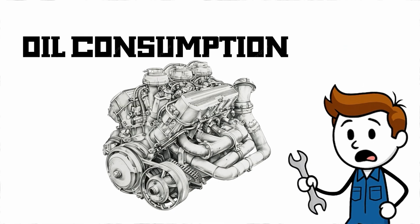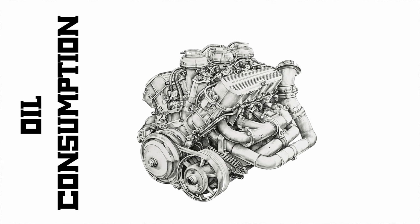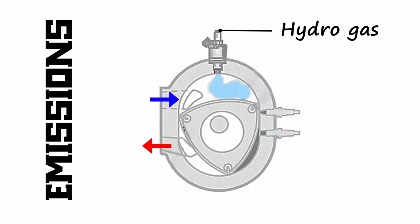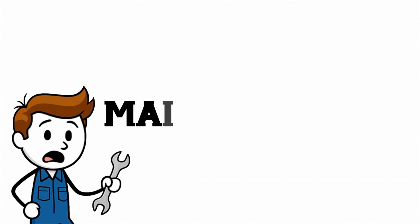Oil consumption. Rotary engines inject oil directly into the chamber. This keeps seals lubricated, but means you burn oil by design. You'll need to top off more often. Emissions. Burning both fuel and oil makes clean emissions tough. That's part of why they fell out of favor.